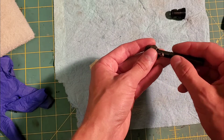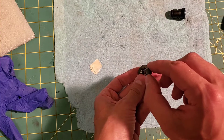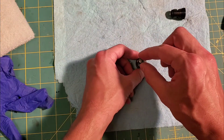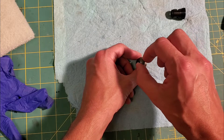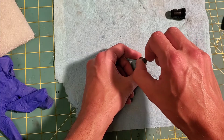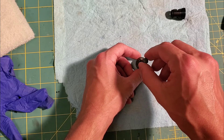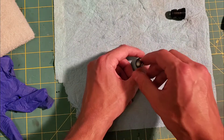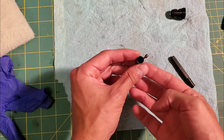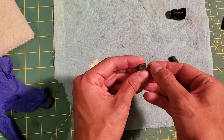It just fits together like this — line your slot up. You just give it a couple whacks with the hammer. I like to turn it 90 degrees and give it a few hits, just light — let the hammer do the work. Let the hammer fall from maybe six inches or so, three taps, and then give it a turn. What you're doing is shrinking the steel back around that ball and socket joint to tighten it up.